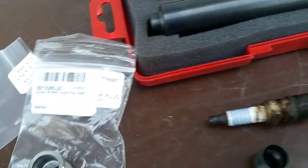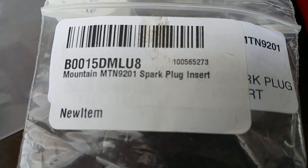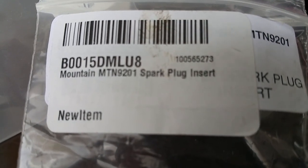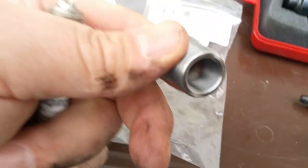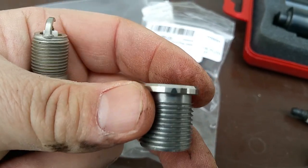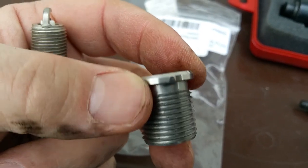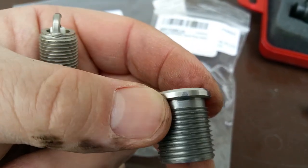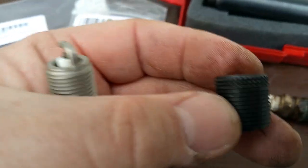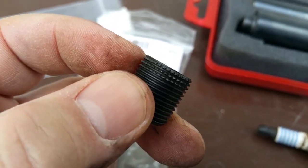The other company I looked at is the Mountain spark plug insert, part number MTN 9201. This one is much larger and also has a flange on top. It utilizes the force from the installation tool to seat tightly into the head — unlike the CTA insert, which is held only by the flange once it's flanged out.